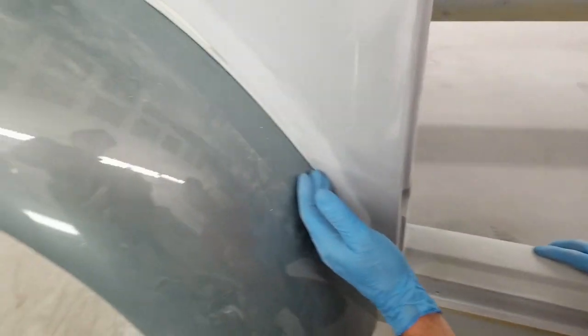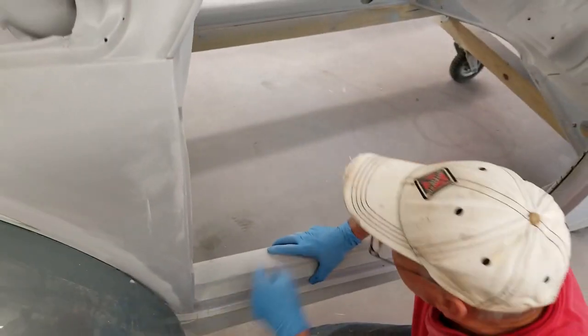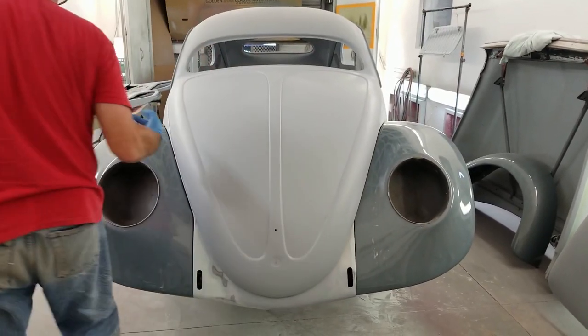We're going to lower the fender to there on both. This looks like hell. And then this one here has got to be filled in. It's going to have to be. This is a completely different shape than that one. Okay, take a look over there and look again. Yeah, it's not conforming. It's not for the clearance on the hood, because this hood is going to rattle around. It'll end up taking the paint off of it.